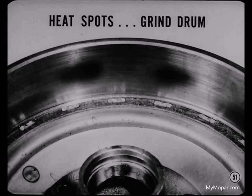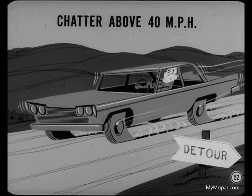Here's another type of brake chatter. If you can hear or feel a chatter during braking from speeds above 40 miles an hour, it's probably caused by irregularities in the drum braking surface. At higher speeds, drum surface irregularities may set up a vibration in the brake that can be transmitted to other parts of the car. By irregularities, do you mean out of round? No — we're talking about irregularities in the drum surface, which should be no greater than eight ten-thousandths of an inch.